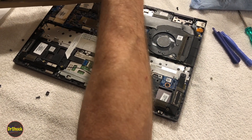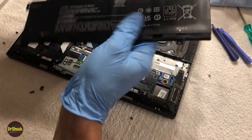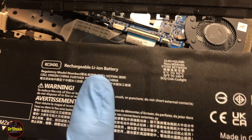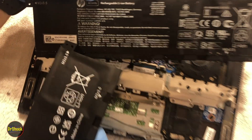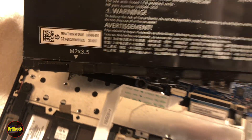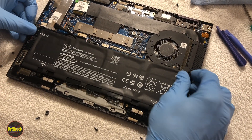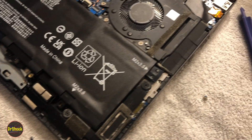We got this cleaned up and we've got a new battery. You can't get an HP one anymore. The number to search by is KC04XL. I'll put a link in the description — it's a reproduction of the HP battery. The actual HP battery number was L08496-855, but that's discontinued. We'll position this in just like the old one. There's a little peg here and there that has to come through first, then we just reverse the order.